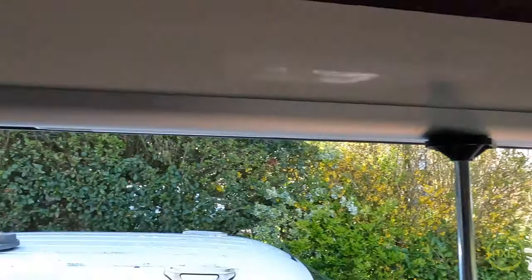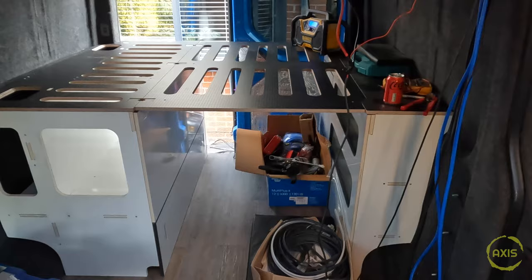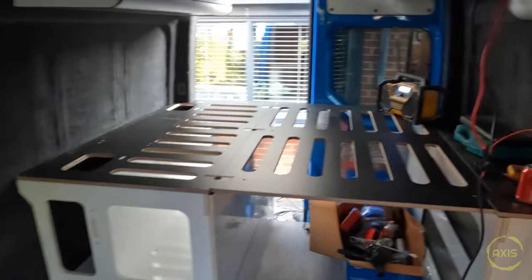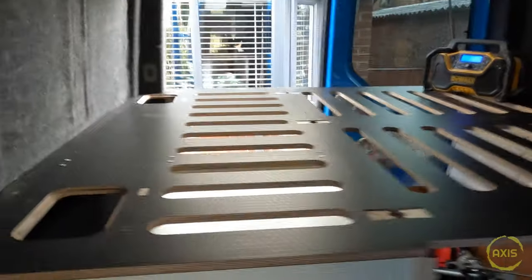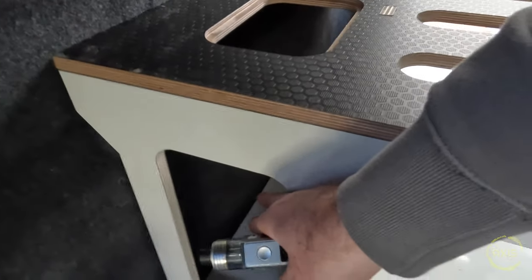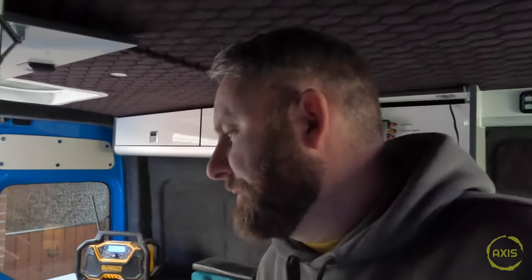We'll let all them set and go off, and then we'll tackle all this. Trial fitted the old bed unit - just fits in there for a pod, just. So that's a bit of a result. Now I need to trim this one back down as well because I think this top frame comes for a pod - it cuts it back, to get it to fit in. I'm not going to screw that in yet until I get the water tank sorted. With this frame now, I can actually put the fresh water tank in this section - behind this panel here there's room all the way through for a water tank. Then obviously the shower bits can come out this way. Once the unit's fastened to the deck you're not getting that tank out. You can service it from the far end - the nozzles and fittings - but that's the plan anyway.